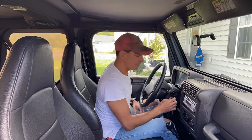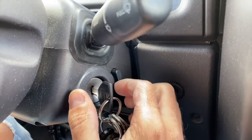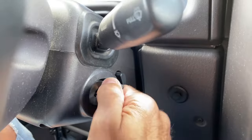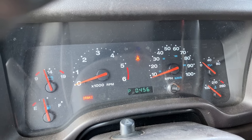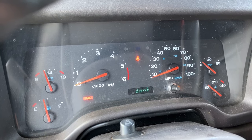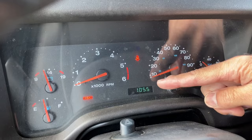Then all you have to do is cross-reference those codes online, or through a forum for the make and model of your vehicle, and you can find out exactly what that code is telling you. So the off-to-on position is here. We're going to go off to on, off to on, off to on, ending on on, and that'll display the code. One, two, three — and there's the first code: P0551, P0456. And now it's saying done. Those are the two codes it found, and then it goes back to your trip odometer screen.